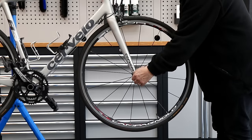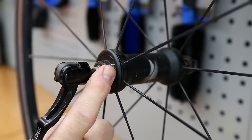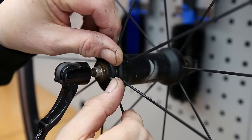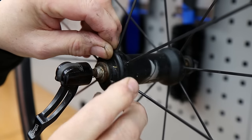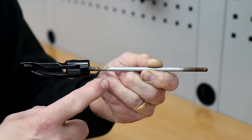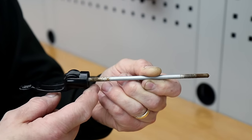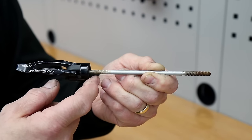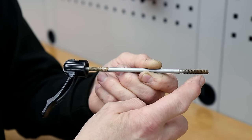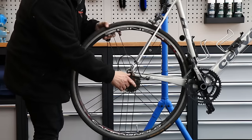Initially with any service I get the bike pulled down, take off the parts I need to clean, and notice things like this — there's a cap on that bearing that's popped off. Simple little thing, just pop it back on and that problem's solved; left alone it could eventually fall off and cause problems. You can also see with the quick release how we've got corrosion at each of the ends. We'll put that through the ultrasonic cleaner, lubricate the threads, and lubricate the shaft so it doesn't bond and grow into the axle.